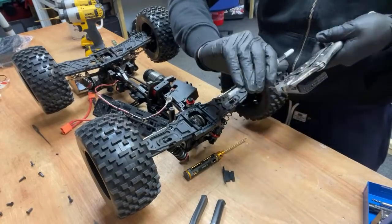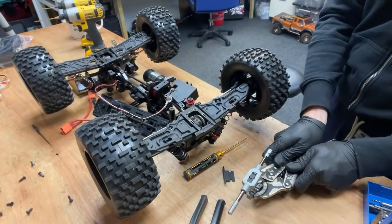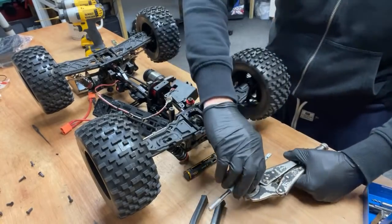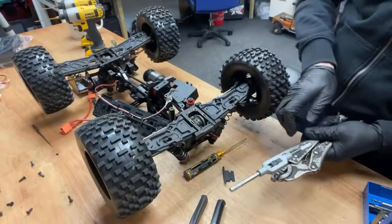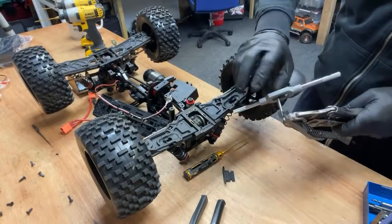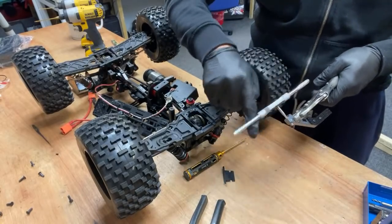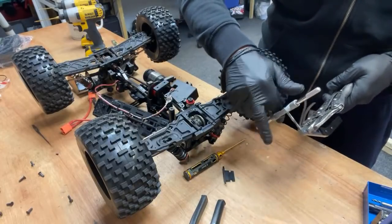No, use clamps. Well, you can use clamps, but saying I want to drill that, I've got to somehow clamp this to the bed of the drill, and then if it's not in exactly the right place, you've got to undo all the clamps, then move it a little bit, then do them all up again. No. Not doing it, dude. If you've got a milling machine, you've got X and Y, and you can clamp it in properly, and then you can just move X and Y to get it perfect. I'm not messing around with all that pillar drill nonsense. I don't like them, never have, never will. But each to their own, you know. Some people love their pillar drills. So if you love your pillar drill, then get a pillar drill. But I prefer milling machines.